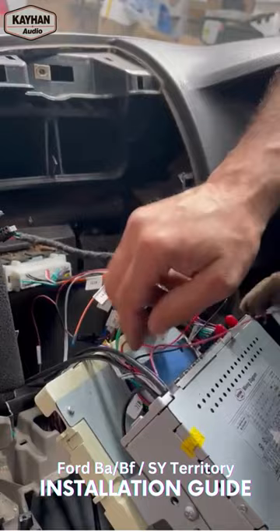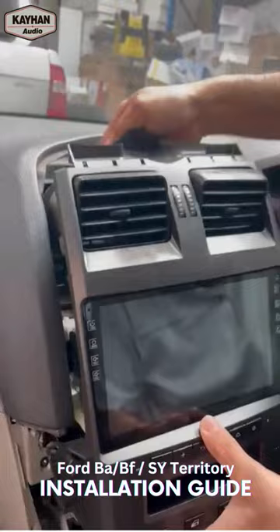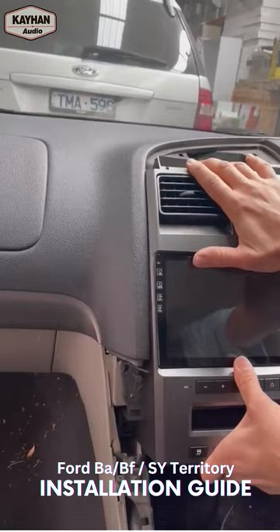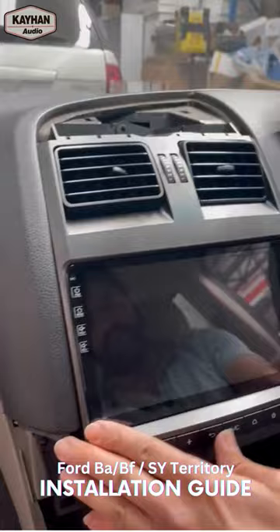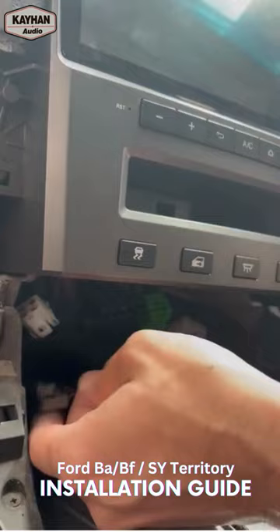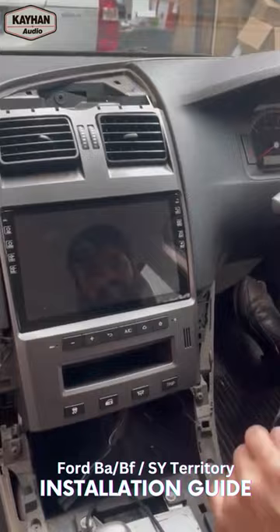It's quite handy to have — a very good little option. But it's up to you. All the AC controls, the climate and stuff, come on the screen and you can control it from the screen. But if you want to make things a lot easier for yourself, then yes, you can grab one of those as well. That fits nice and neatly right where it needs to be — just hit the click on the two sides and that's perfectly fine. Then we have to plug in the BCM modules from the bottom. Those four plugs that we unplugged, we have to plug them back in, give it a shot and check everything is working. Don't forget your radio antennas, and that's your cigarette lighter power — so you've got six plugs in the bottom here.